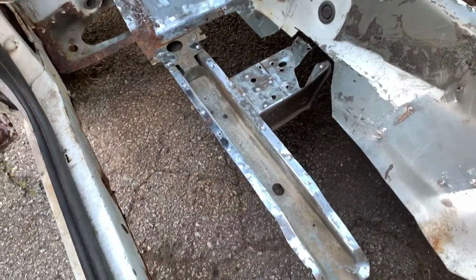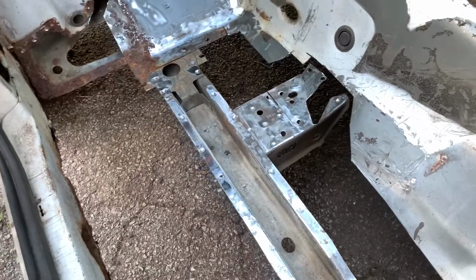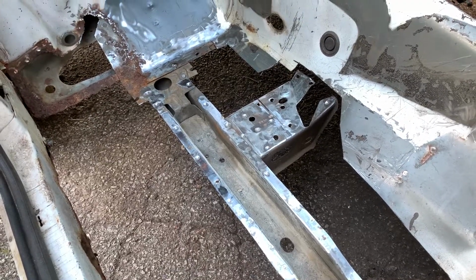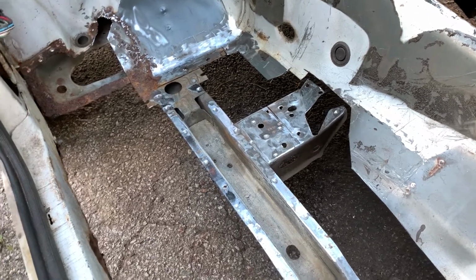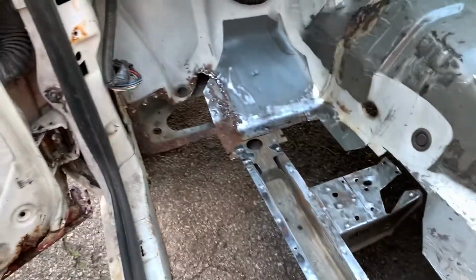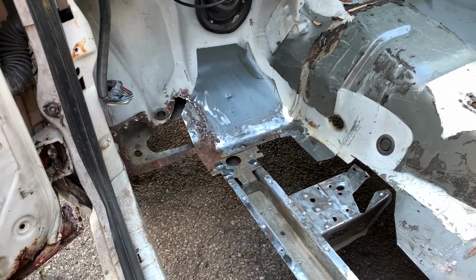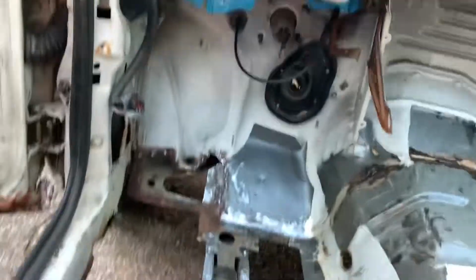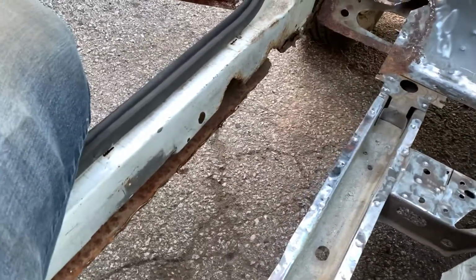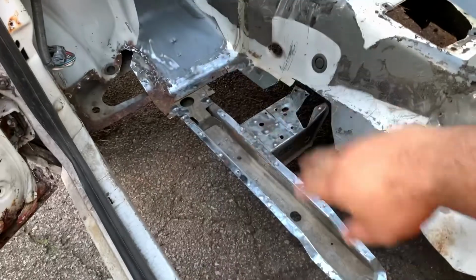A lot of the metal is actually in pretty good shape. A lot of it was just surface rust, so I went ahead and got all that down to bare metal. What I'll do now is weld all those holes that I made, fill all the spot welds that are kind of deep, and then paint that. The stuff in here I will hit with the Marhyde probably in the next video, and let the converter do its thing. I did get a little bit of the inner rocker cut out. It wasn't too bad. I won't even say cut out. I cut a couple spots and it literally fell out. So this is what we got going on right now.